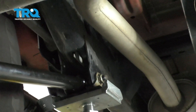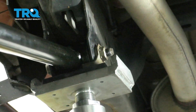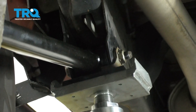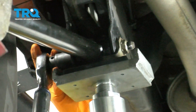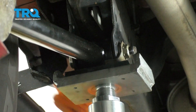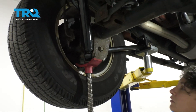Now I'm going to move to the front and you don't need to put a wrench on it. This one's 117 — so the upper closest to the driver's seat is 117 foot pounds. We'll go right out here on the outside. Now we'll just lower our pole jack, or if you have a jack, take the jack stand out.